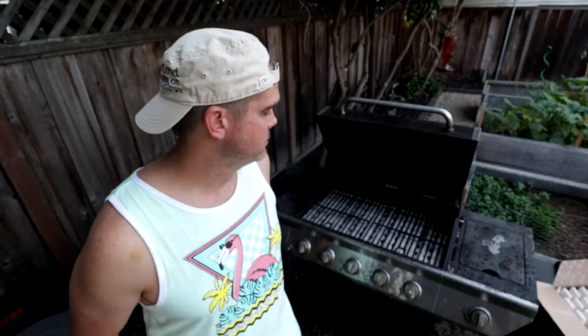There we go — job done. Got the bottom of the grill cleaned out, all the little holes poked out, all my elements are burning full, igniters are starting the grill on their own. Cut the new rock grate in and put the briquettes in. It took 91 briquettes to do a 14 and a half by 26 inch grate, so this might give you a little idea of how much you need for your project. I still have half a box left. Pretty much the only thing we've got left to do now is kick on that heat and grill some meat.